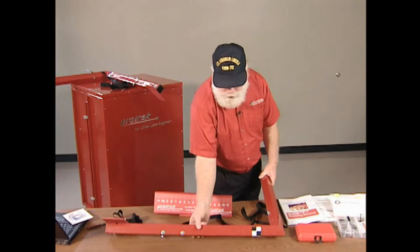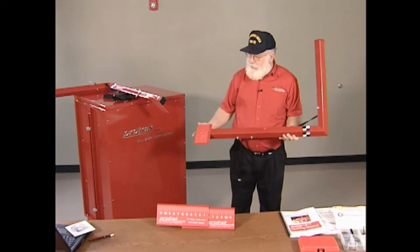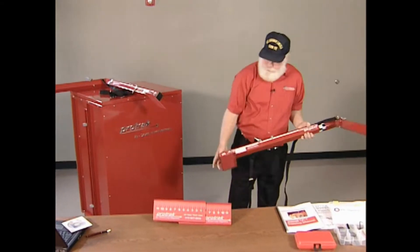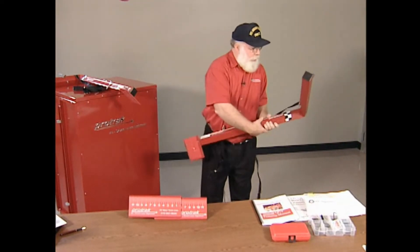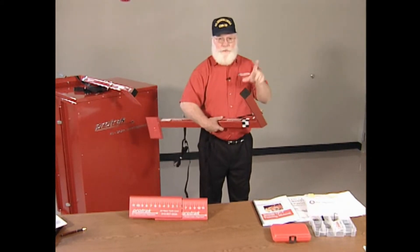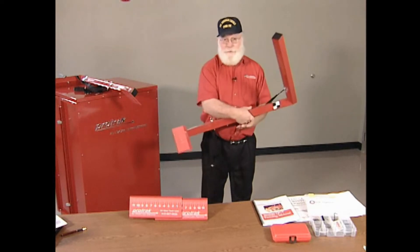The system also includes two bars with straps to hold them on the tire. The bar has double-A flashlight batteries in the top and one switch that turns it on. There is a laser shooting out of this target and there's a laser shooting out of this end. The two lasers form a great big framing square — the whole system is based on the concept of a framing square.